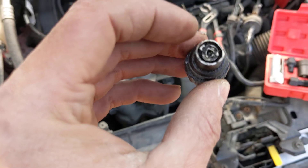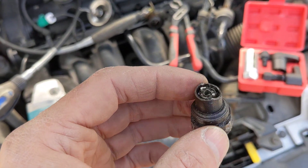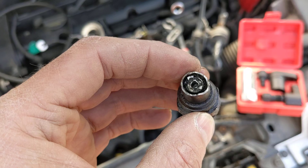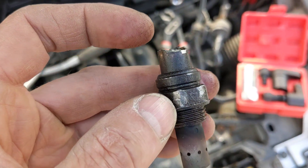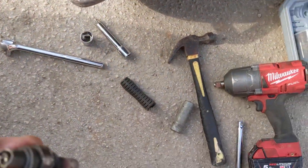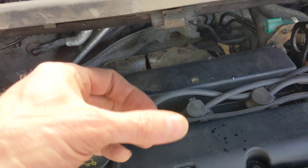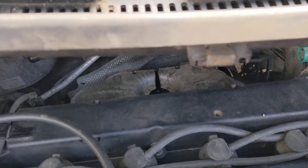And then I ground chunks off the top of it. Now it has got a ceramic core. So I used the Dremel and the angle grinder combination to cut around and then literally tear the top of it off, break the core down, and I kept grinding down to reveal that. That way a normal 22mm socket would fit over. Even though I've got an impact gun, I couldn't get the impact gun in here to give it any useful torque — it just was of no use.